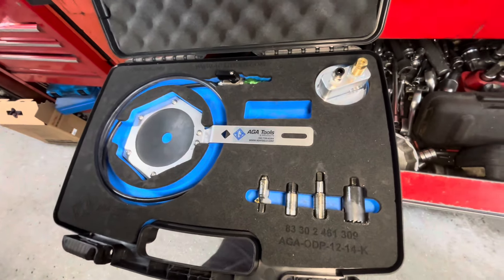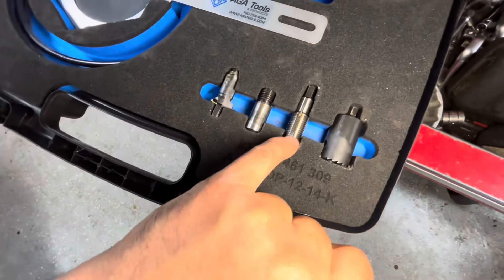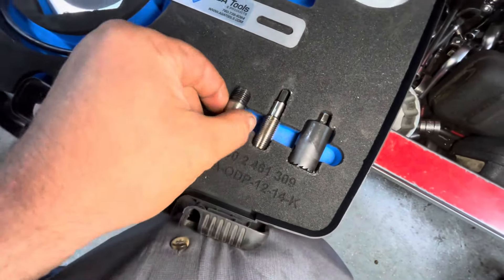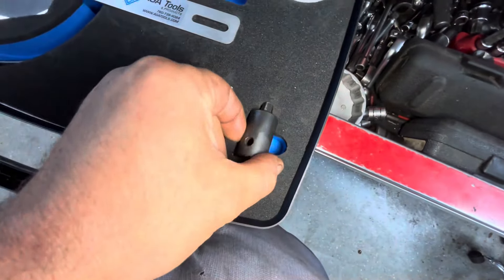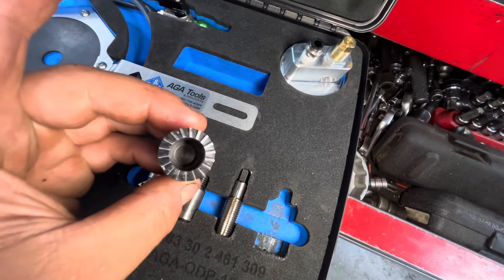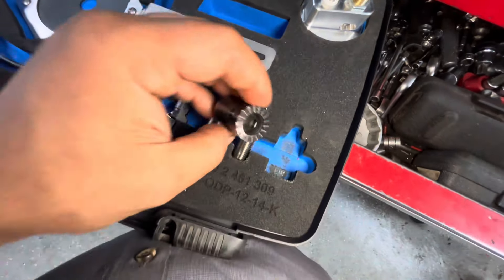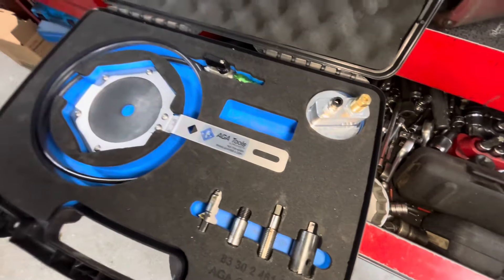You'll need to put a rubber seal on it or something like that. But if you use this kit and you drill it and you tap it to this size, you then install this little collar. This just threads right in — it's the same thread as the tap. And then what this does is it rides on that post hanging out the bottom of the oil pan, and it cuts the seat so it's flush with whatever angle you ended up drilling it out at. So it gives you a really nice fresh seat, and then it shouldn't leak when you're done.